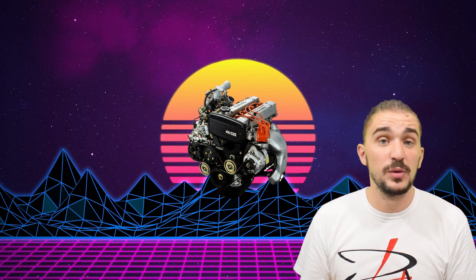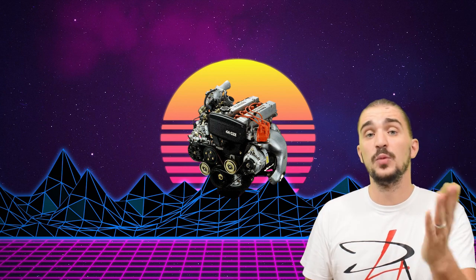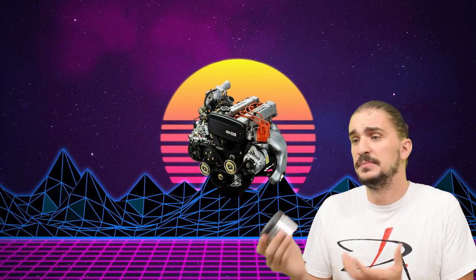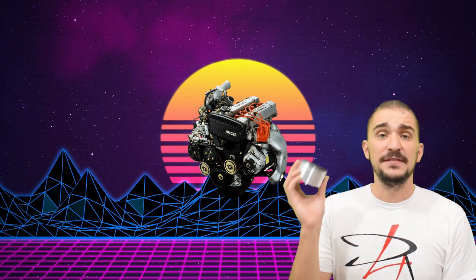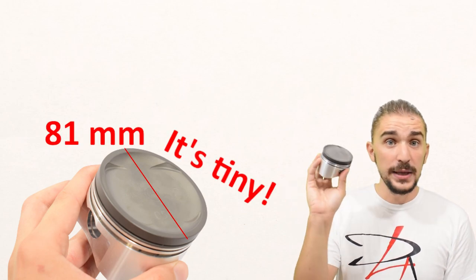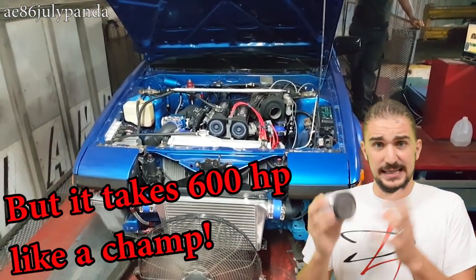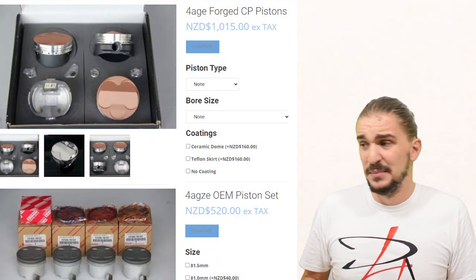And there you have it. I hope this video manages to clear away some of the misconceptions when it comes to the term semi-forged, and to end a debate that has been going on in the forums for years. No, they're not forged. But yes, they are very good. This is a pretty impressive piston. It's not semi-forged if you're talking about its manufacturing process, but it does have the mechanical properties of both forged and cast pistons, which is why the term is sort of justified. Many people have taken this stock OEM semi-solid cast piston to around 600 horsepower — very impressive — and it costs half as much as aftermarket forged pistons, with better wear resistance and less piston slap. This is why it's going into my turbo 4AFE build that I'm calling Project Underdog.